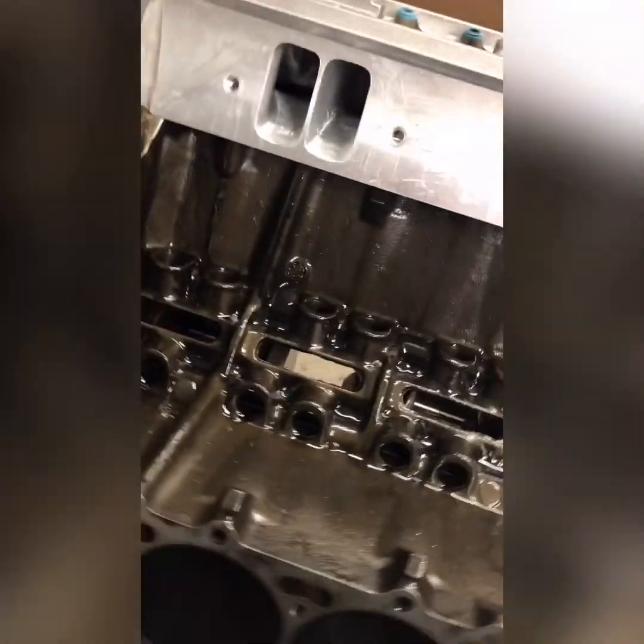Right now I'm working on my heads and my engine block. What I'm doing is I took the pistons out of my block so I can scribe my combustion chambers and unshroud my valves if able to, because this does have a 55 thousandths over bore over stock. I believe these heads are made for a stock bore minimum, so at the minimum I could take 55 thousandths off. I'm about ready to find out - there's my heads on there, a little sneak peek.